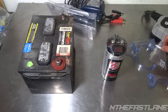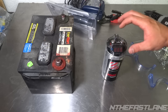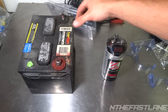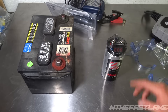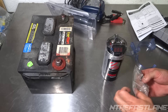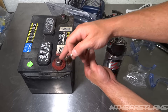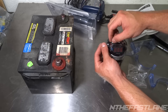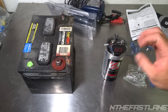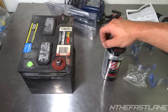They supply the diode in this package right here. What needs to happen is we hook up the ground first to the vehicle, then you have the other ground run into your amp, and the positive run into your amp. But the main wire that comes off the battery terminal you don't hook up just yet. We take the diode, and let's say this is the imaginary 12 volt wire running from the battery — we touch it here, just hand tighten it, then loop it on the wire. You just watch the voltage; it'll start flashing when it hits 9 volts, then get to about 12 or 13.4. Then all we do is pull the diode off and connect the positive wire, and the capacitor's charged.